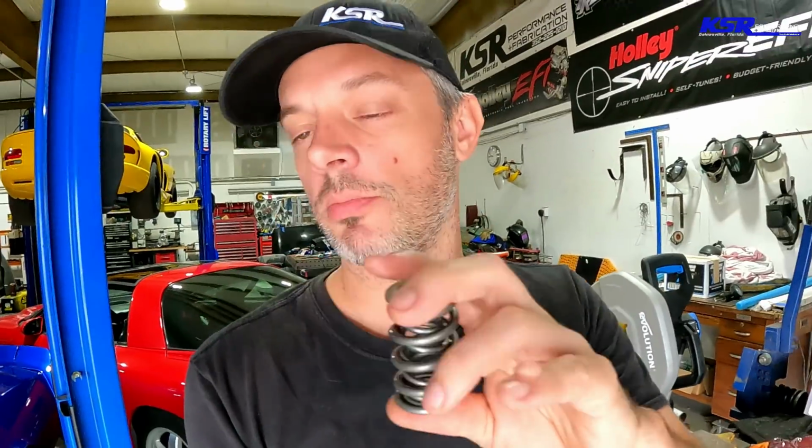A valve spring, like anything else, is a wear item on a race car, especially beating this thing up, especially when you're trying to turn big RPM. We still have a hydraulic roller camshaft in SoccerMom, and things have to be perfectly right when you've got a hydraulic roller cam and you're trying to turn this kind of RPM. So through some testing, we measured the spring pressures at what's called the installed height. So the actual height where the spring is compressed when it's captured between the cylinder head and the valve retainer, or the spring retainer that's on top of the spring.